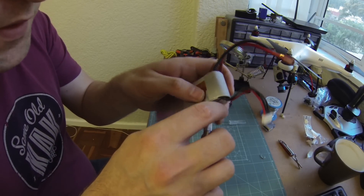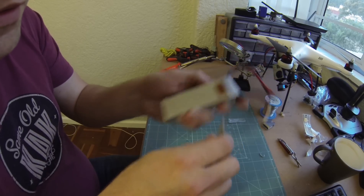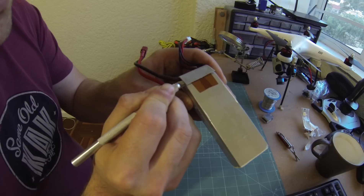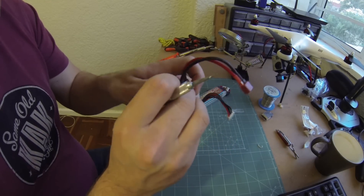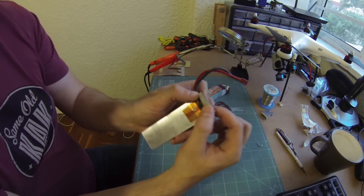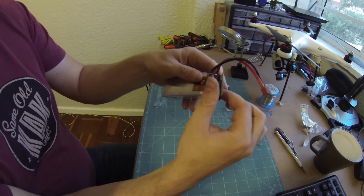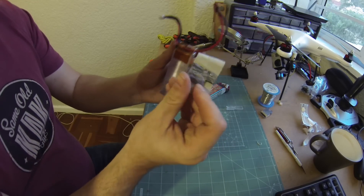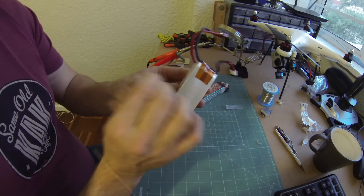I'll separate this piece of cardboard cover — just gently slide it underneath and the adhesive gives away pretty easily, but you obviously don't want to overextend the blade and hit any of the contact points or wire. If you lift that side you can see there's a little piece of foam that's been adhered onto there. Just get it all the way around and down, and keep that. Then just clean up any pieces of tape that are still around.